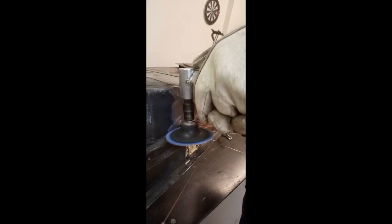On this side we want a little nicer result — we want to try to metal finish this as much as possible, then come back over with a skim coat of glaze. That should take care of it and make everything look really nice.